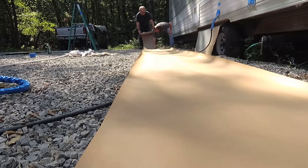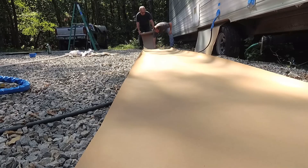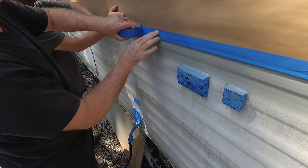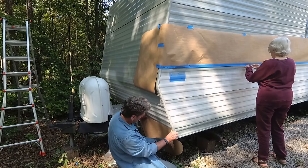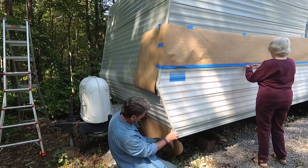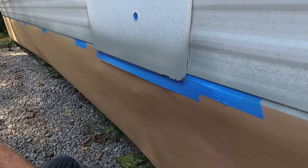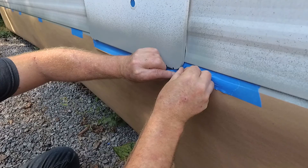We've got a three-foot roll of craft paper and we're going to slice it down the center to use to mask the top and bottom. You're going to want to run your tape the full length anywhere that paint could get underneath — you do not want bleeds. Take the paper low enough to set some tape but also low enough to run a whole strip of tape all the way across. Working around parts like doors and hatches takes a little time but it's well worth doing properly.